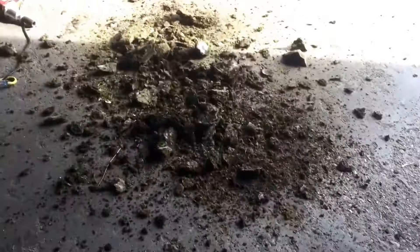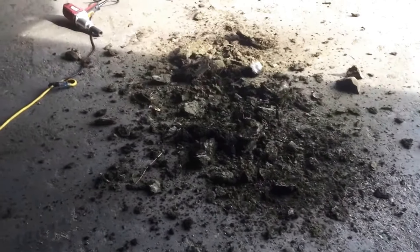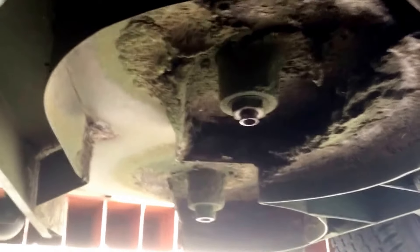That's just a tremendous amount, and that's just around three of the spindles. I've already taken the blades off because I wanted to sharpen them. This one here I've cleaned out and it's nice and clean and smooth. The one in the middle I haven't got to yet, and you can see just how caked up it is. Imagine the blade being on top of there and trying to pull that grass up, sucking it up and then cutting it off — with the airflow around that center spindle, it would just skip grass, or it wouldn't cut it, or it would leave long strands here and there and I'd have to go back over it again.